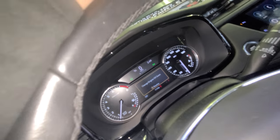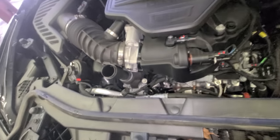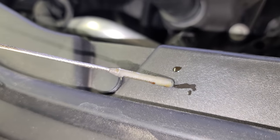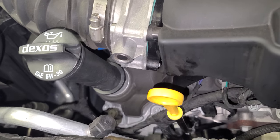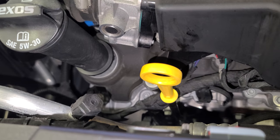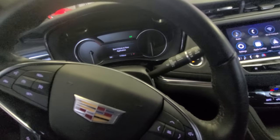In that hot minute I'm gonna check the other fluids, then I'm gonna shut the car down and check the level again just to make sure. The book says six quarts. It takes five and a half synthetic 5W-30. I poured five, let it run for a minute, shut it down, checked again - five was at the right capacity so I poured another half quart, so it's five and a half.